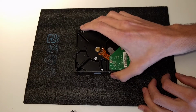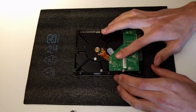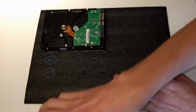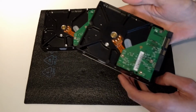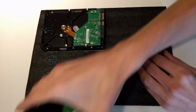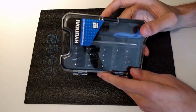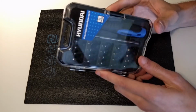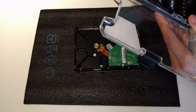So what I'm basically going to do is take this PCB board from the new hard drive and put it on the old one and check if that works. So these are the tools I got. I got them from a local store. I will leave a link to a similar product in the description.